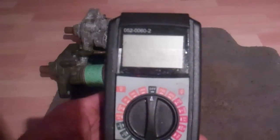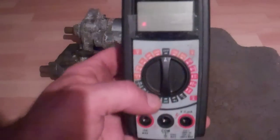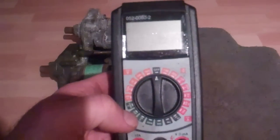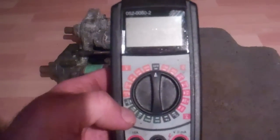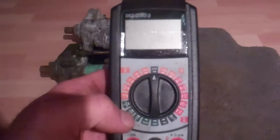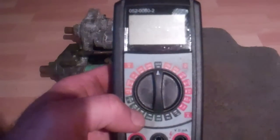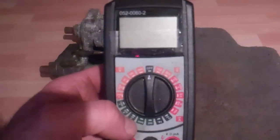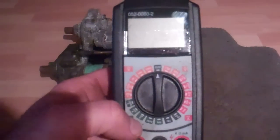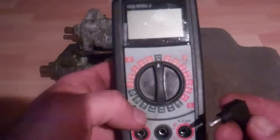In this video I'm going to talk about using an ohmmeter for troubleshooting vehicles, but just generally troubleshooting in general. What an ohmmeter does is actually puts current through a circuit to verify that you have continuity in the circuit, so that basically you don't have an open circuit. I did another video about reading voltage measurements, so if you want to look at troubleshooting voltage stuff, you can look at that video.